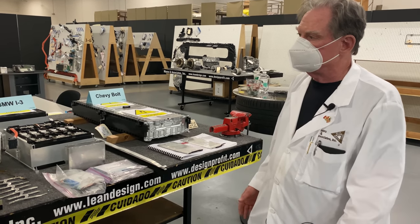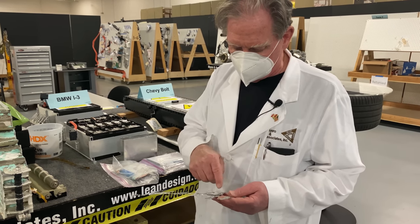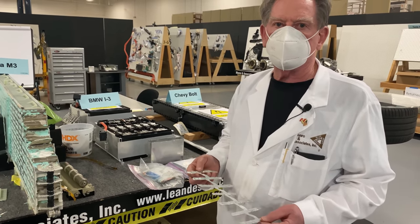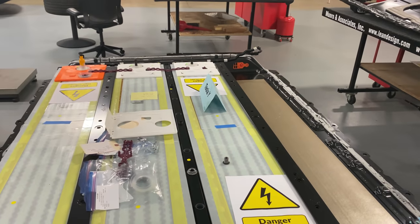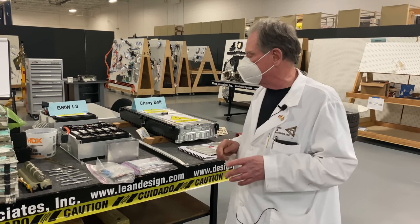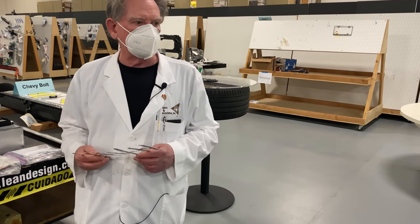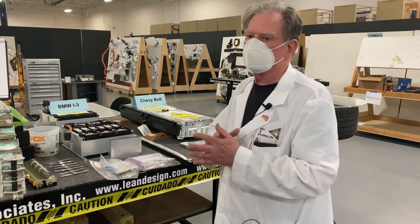Another thing that's nice about it — I told you that these collector plates here comprise the brick. What happens if one or two of these little connections don't connect anymore? Well, each one of these little 2170 batteries is three and a half volts. And at three and a half volts, if you lose one or two, it's no big deal. The component that sits underneath those white and orange covers there — that's for battery management. And that'll balance the batteries for the little bit of differences that there'd be if one of these cells decided to die or if one of these little wires somehow got broken. When we did the balance on this thing, the difference was minuscule — it's the smallest differential we've ever seen. We're expecting to see the same thing when we do the testing on these batteries over here.